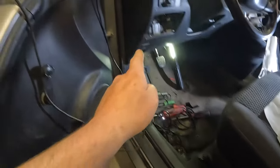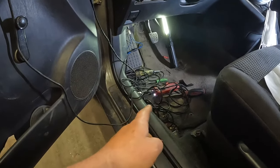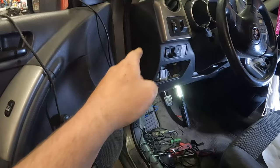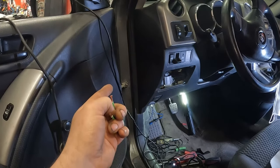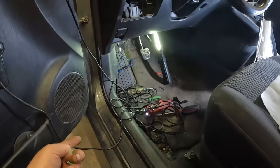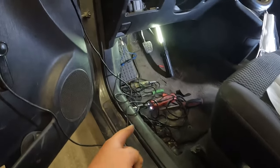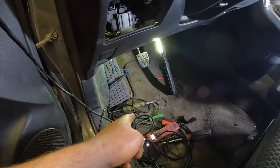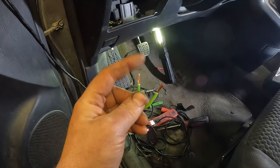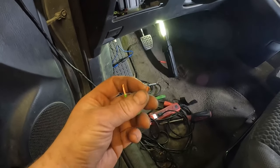And now what we want to check is the power feed coming to it. Now, we saw that light up red, but that's not necessarily to say that that's a good enough connection to close that starter solenoid, right? You might have a bad connection, so it might be enough power getting to that for that power probe to register it as a power because it's unloaded, but you want to load test it, right? So we could put in a high amperage test light, not that thing, something bigger than that, a bulb, or why not just jumper the two, right? If we put this end in the full-time power and this end going to the starter, and she cranks, then you know it's capable of cranking.